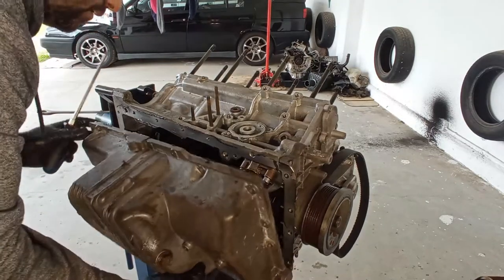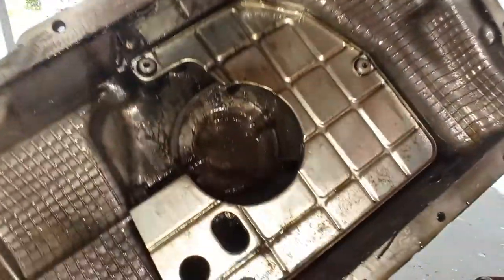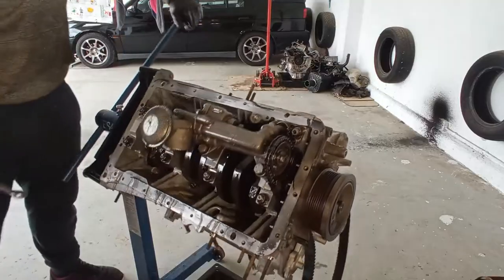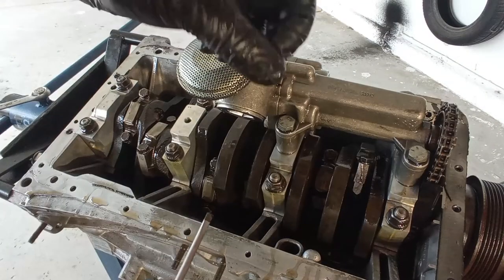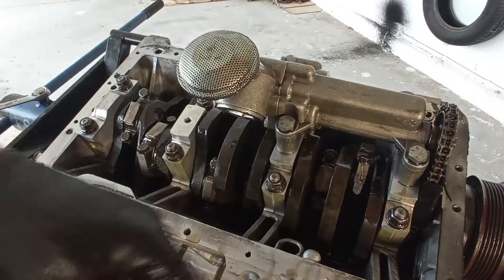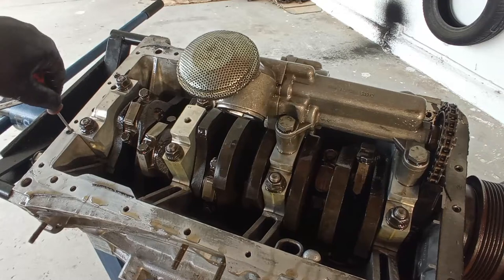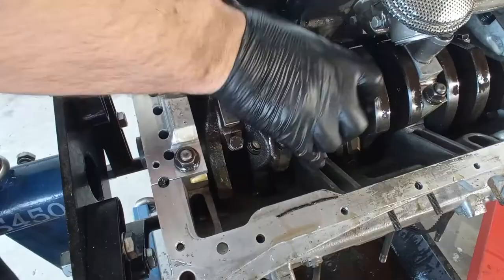Okay. And for my surprise, ta-da! What the hell? On a new engine! This is the confirmation of the problem with the pistons. Here on the intake pipe for the oil, hair and glue, the seals are not present, just RTV, and not full of it in any way.